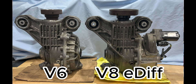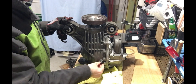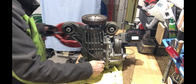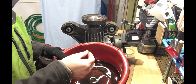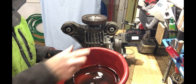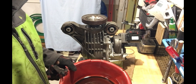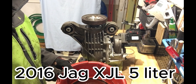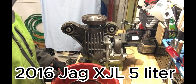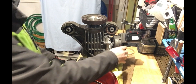We're going to take this unit apart. We did find oil paste on the drain plug, and we have drained the oil from this unit. There's no fleck, but it is pretty dirty — pretty black. But it's still oil, still functions. So I think this unit is in pretty good shape. This came off a Jaguar XJ V8, I think 2016-2017 model year. A lot of different Jaguar V8 models carried this E-Diff with the large clutch pack.